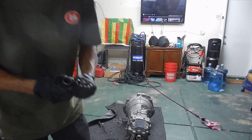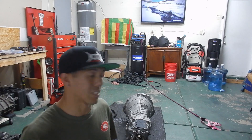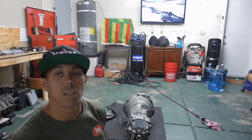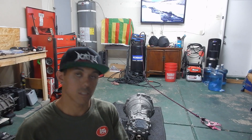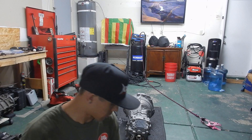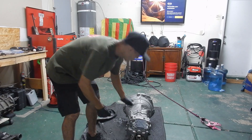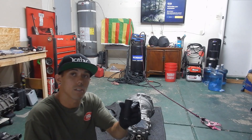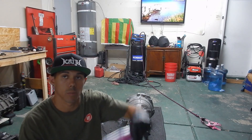So what you're going to need for this job to go smoothly — and this is just to take everything out of the casing, not when you get inside the casing with snap ring pliers and all that — we'll go into that later. You're going to want a 27mm bolt, a 10mm because every single bolt on this is a 10, and if it's not a 10, it's going to be a 14. We also have a 21 for both sensors, and then a small magnet. Use Ziplocs — very important. If you have bins, even better. And a Sharpie so you can have everything labeled and ready, making it a lot easier when you put it back together.